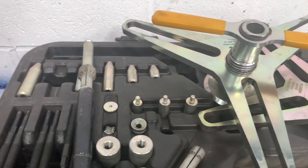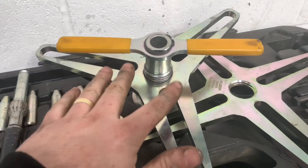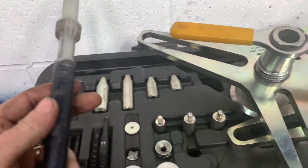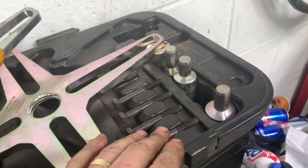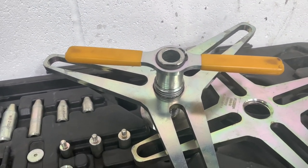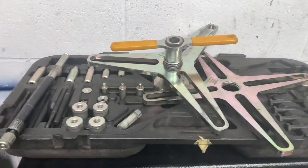For those who don't have a pre-tensioned clutch, you have to use the alignment kit. You get the right size studs, put three into the flywheel, put the tool on and tighten it down until the pressure arms are close. This tool has multiple attachments to line up the friction plate. Once the studs are in, nip up your bolts — don't torque yet — then release the pressure slightly and then torque them down.